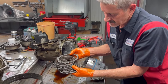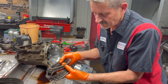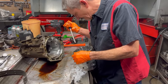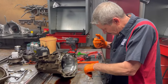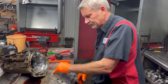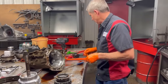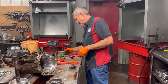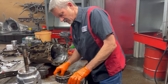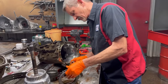This little 6-clutch here just won't stand a chance. You can start beefing them up but they'll only last for a little bit — it doesn't take much to take them out. You've got to bump the pressure up so high in the unit that you start breaking the pump and all that. It's amazing how much pressure you have to put in some of these factory units to make them work. If you put a cam in them and they don't have the money to build their transmission properly, you can't skimp — it'll take that tranny out instantly.